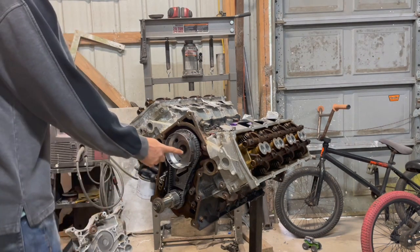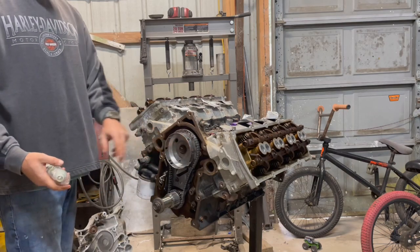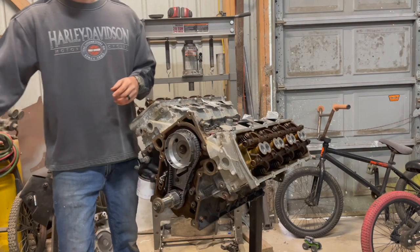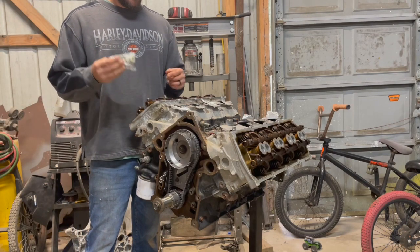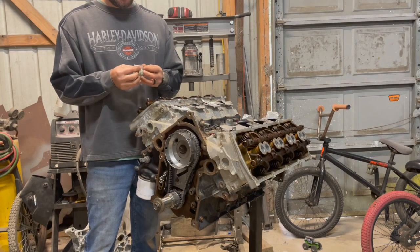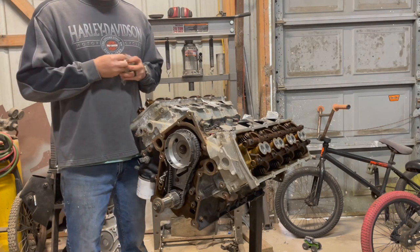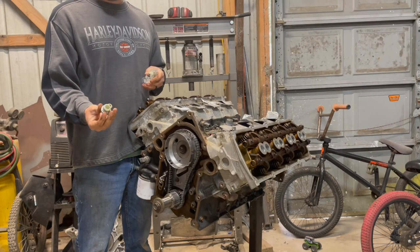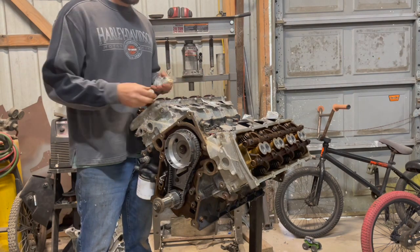All right, the torque spec on the bolt was 90 pounds. Got that torqued. And now I'm waiting on some stuff soaking in degreaser. I'm going to throw in the MDS plugs. We got these on Amazon, I think. They were like $14 or something like that. It's just a plastic plug with 2 O-rings. That's just going to take the place of these ports.